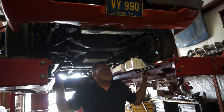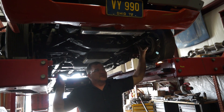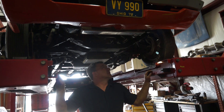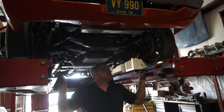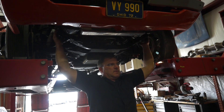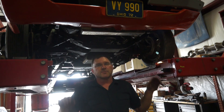I'm finishing up this alignment. I needed to clearance the upper control arms because when they drooped they were actually contacting the subframe. I tightened up the caster rod — my caster is within a tenth of a degree, and I can fine tune it right here just by rotating this adjustment and then locking down the allen bolt. This car, when it lifts on launch, actually toes out, and it toes in on rebound when it drops. It's almost a degree of deflection, so a bump steer kit would be very beneficial for this car.